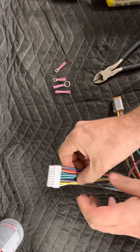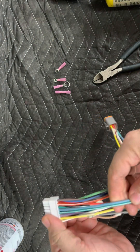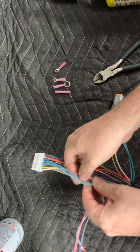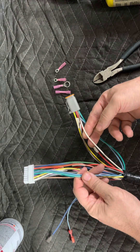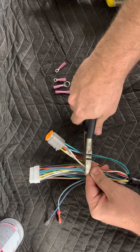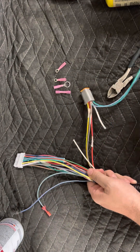Find the blue wire and the green wire with the white stripe right here on your main connector. Hold them down right here. Then pull the white wire up from the OBC plug and cut them all at the same length. Then pull the green and the blue out — you're not going to use those.